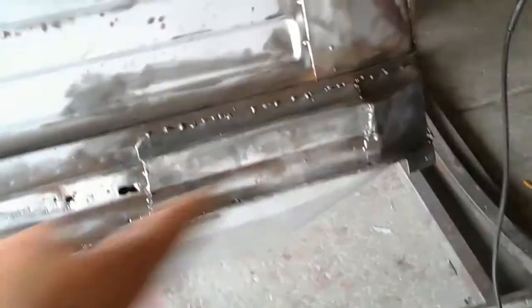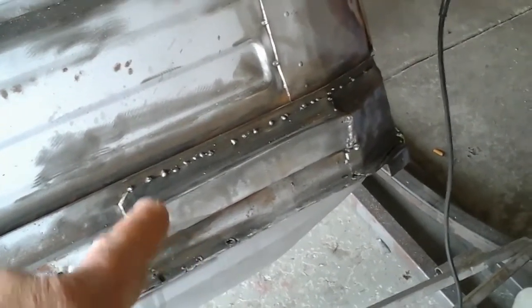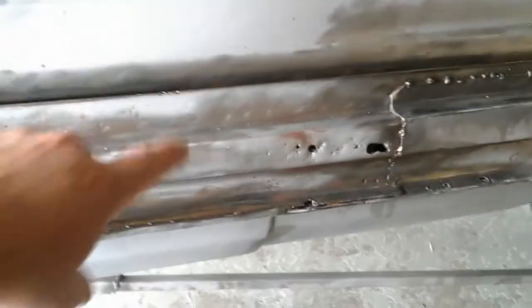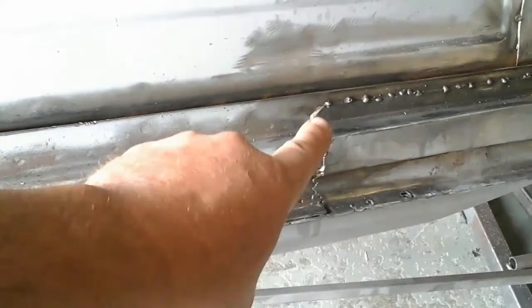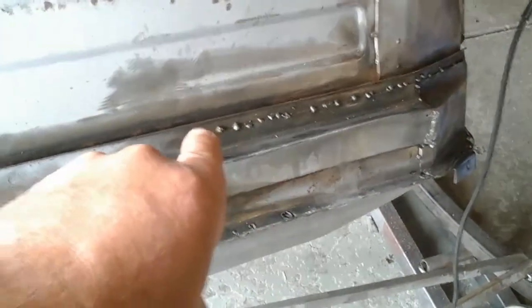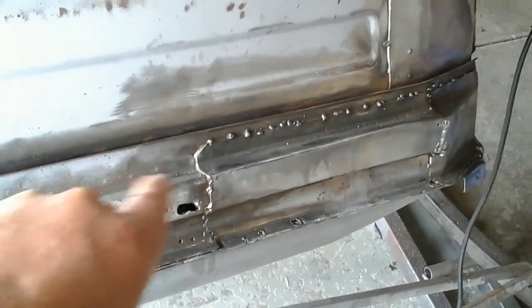Dave Hamley, Glory Days Automotive Restoration. Jason and I are standing here discussing how we're going to repair this frame rail. This is a frame rail repair that I've already discussed in past videos, and if we really stand here and look at it and decipher it, what they've done here is taken the old original factory frame rail and this patch — for lack of a better term — they set over it. There's probably a rust hole very much like these underneath this area.